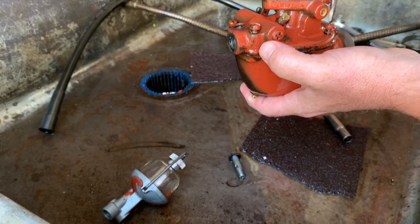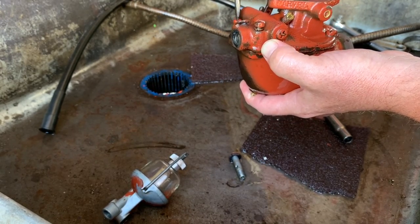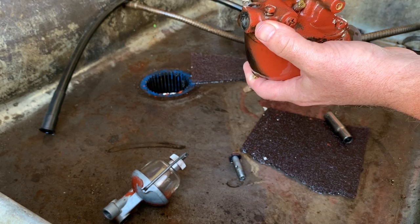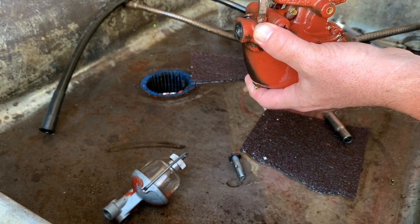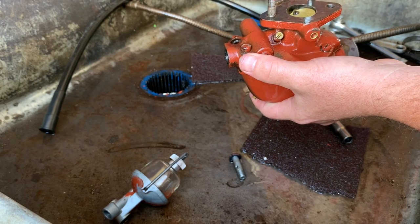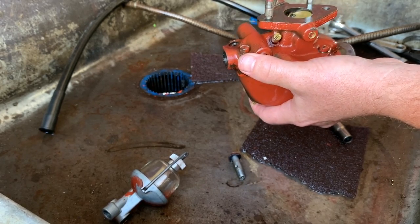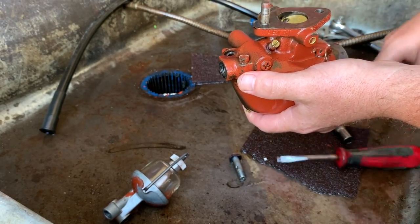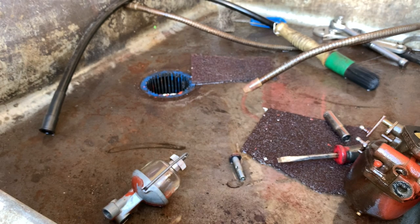Do your future self a favor and use pure gas, and you won't be tearing carburetors apart. Ethanol absorbs moisture out of the air, then it becomes useless fuel because it no longer functions — it crystallizes and gets crap everywhere inside your carburetors. It works in your cars because you're not leaving a tank full of gas for months at a time; you're burning through it and putting fresh in. Ethanol was a terrible idea to subsidize into fuel. You shouldn't burn what you eat — people eat corn, animals eat corn, so it should not be used as a fuel.